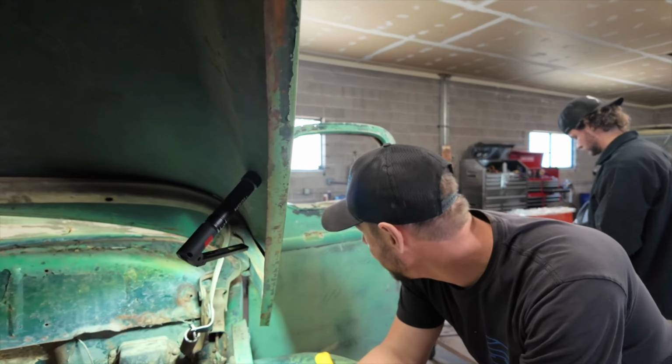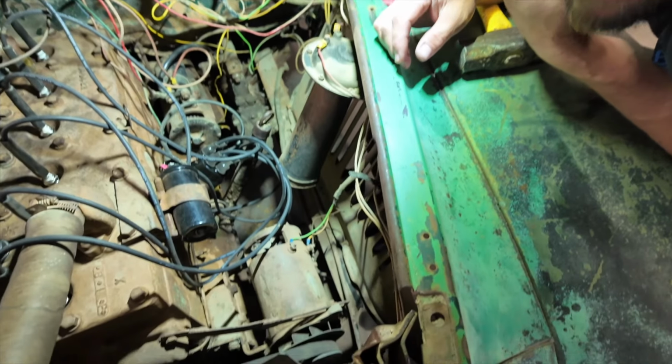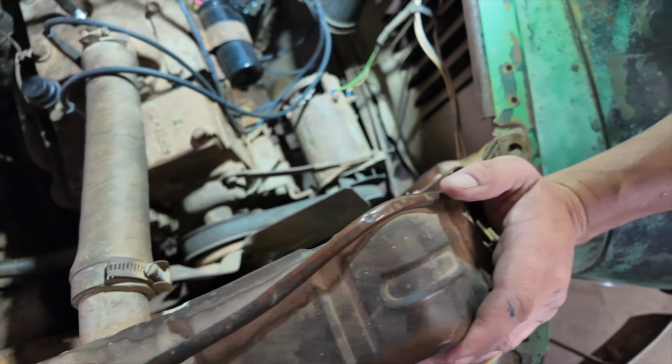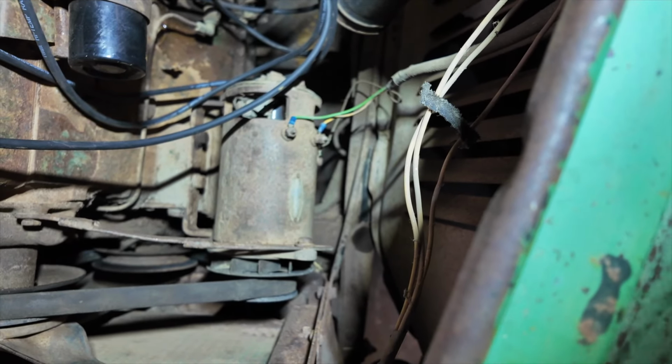All right, Johnny's out of town. Wally's out of town. Stubbsy and Caleb have gone kind of crazy with the truck here. What's going on here? Okay, well, we dropped the tank, cleaned it up, got it all hooked up, all the fuel lines, carbs. Gonna run regular water through it to clean it and drain the radiator, and then put antifreeze in. But we put our water in, and our freeze plugs on the side leak. This one was really bad.